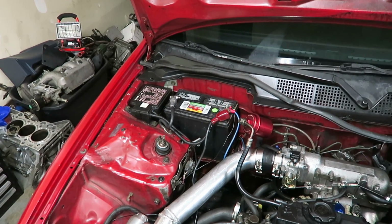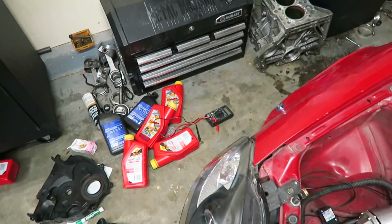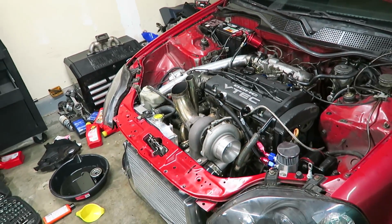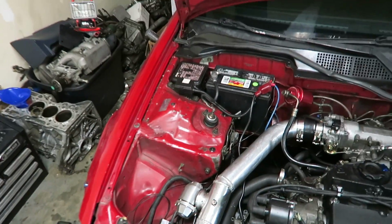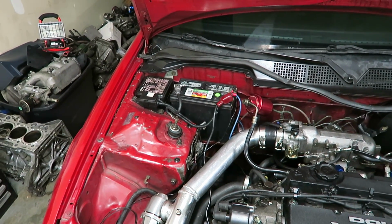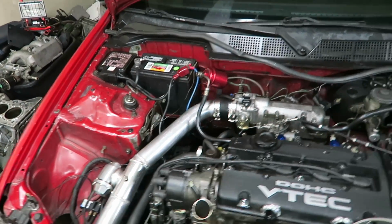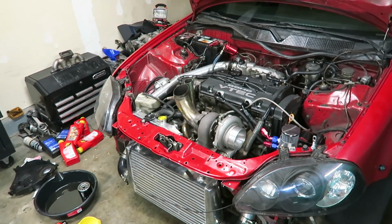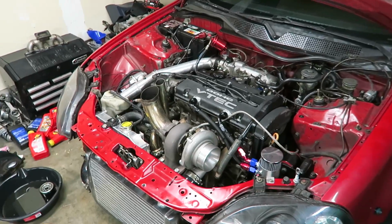And I just parked it here, left it, and it only had like maybe 10 volts at most. I had my voltmeter hooked up to it. Went to AutoZone, got a new alternator, came back, and then I left the voltmeter plugged into it. And then it said it had almost 12 volts again, just sitting there. And the car started again, even though it wouldn't start before, and I did not touch the battery at all. And then I went to drive it around, and it seemed like it was charging fine on that alternator I pulled out of the shed, but the battery light would just start to come on again. So I didn't know what was going on with that. That was kind of weird.